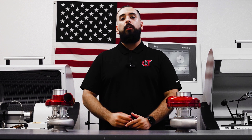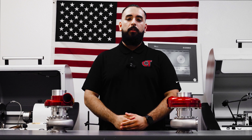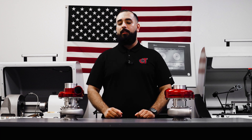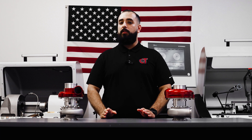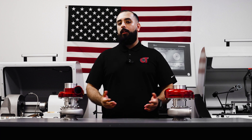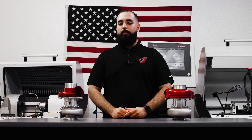When it comes to this particular grease, we do sell it online and over the phone, and it's also available through our dealers. Our cartridges do have a Zerk fitting at the top of them, and because you no longer have to abide by the rules of gravity, the turbocharger no longer cares how it's oriented — it can be mounted completely vertically or horizontally. Ideally, you'd like to mount it whatever way is easiest for you to be able to access that Zerk fitting, which is where you'll service your turbocharger from. It works very similarly to anything else that uses grease.